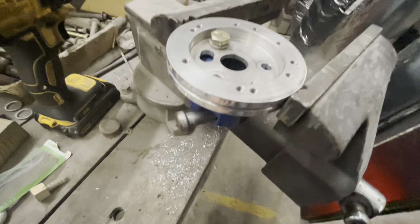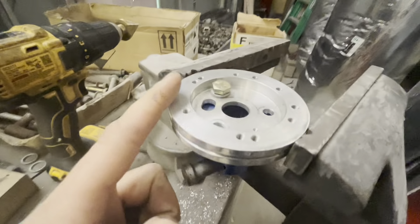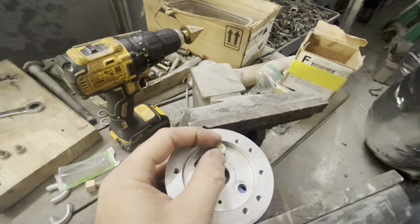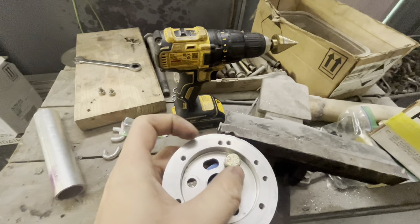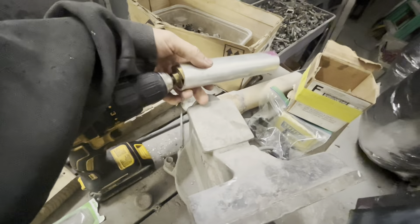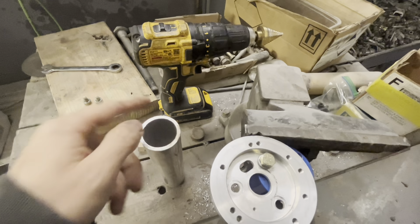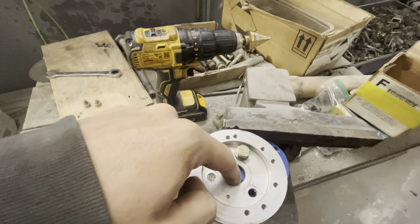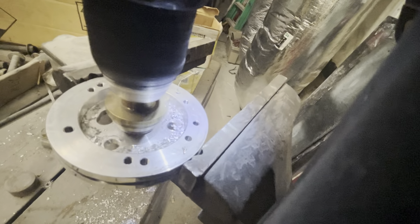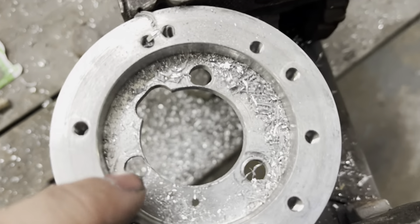I had this piece bolted together — you got your quick disconnect and I've just got one bolt in right now because I'm about to pull it out. It's bolted onto your hub adapter, which goes from three bolts — this is actually universal, one to five or six bolts. All I'm doing right now is taking this apart and then stepping it down with a step-down bit to this size, which is the inner diameter. If I step this down to the inner I'll be able to line my walls up to make sure this pipe is centered.